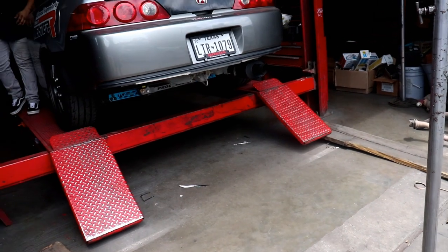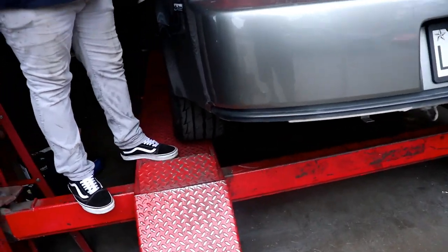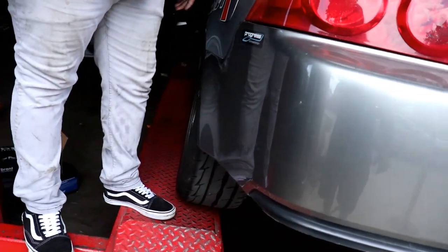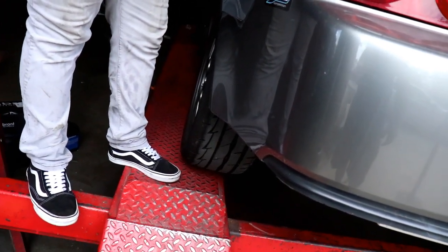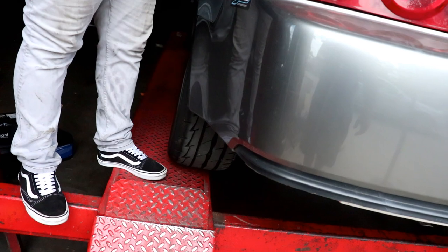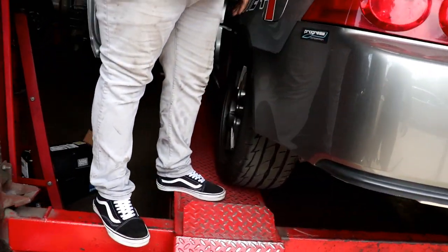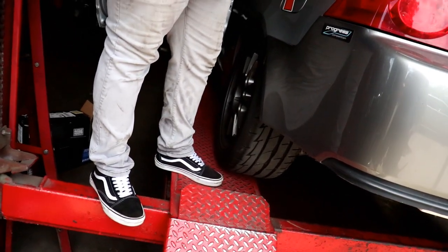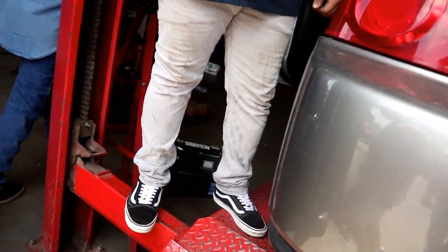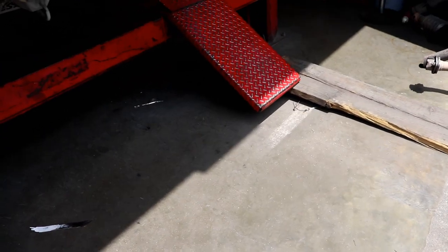I think you have a bad mount. What's that? You have a bad mount. When you kick it on and double-tap the floor real quick, it jerks forward. Yeah, my engine mounts — I've been needing to replace them for a while. Only noticed it on the start right now — when the motor cranks over, you know how it vibrates? Boom, it hits one time and then it turns on. Yeah, they're the original ones after 140,000 miles. I'm gonna get some Hasport ones and all that. Thanks man — that's how it's supposed to sound.